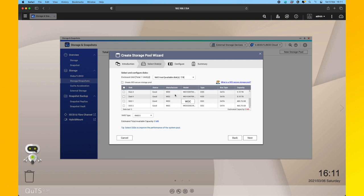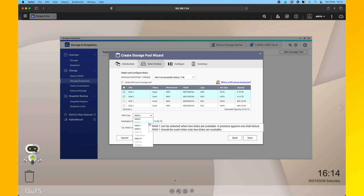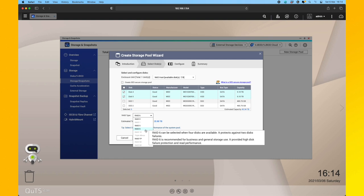A storage pool combines many disks into one pool of storage space. We have seven out of nine drive bays populated. There's a dropdown here for if you have an expansion unit connected — you could create another storage pool with your expansion in the future. We just have the NAS itself. Further down we have the list of drives. We'll select all five of our hard drives — one, two, three, four, and five. After selecting the drives it automatically selects a RAID type, and the RAID types we can't use are grayed out. If you're unsure what a RAID type does, there's a little description provided.